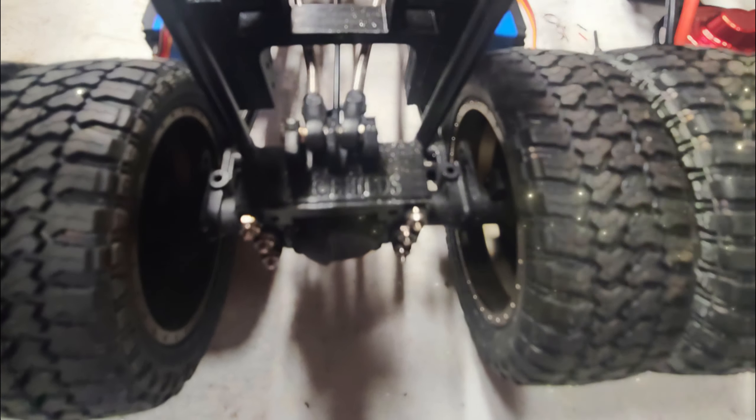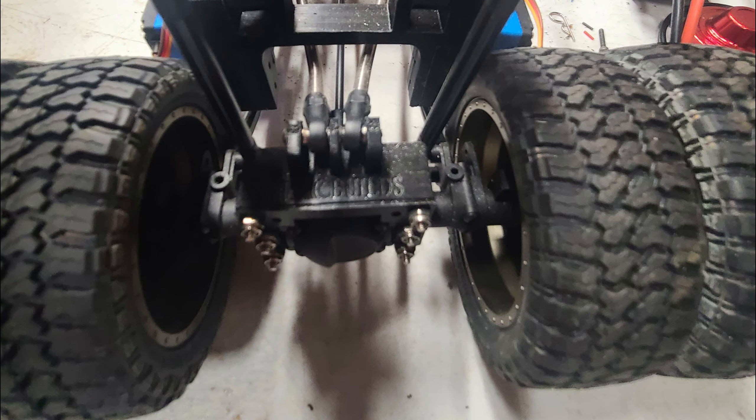In this shot you'll notice that the rear differential — the rear end — is chopped. Had to cut quite a bit off each end of the housing and the axles to narrow the wheel track enough to get those dually wheels to fit up underneath the bed. You can also see the four-link mount for the rear.